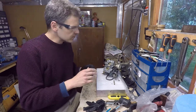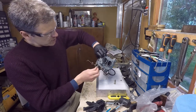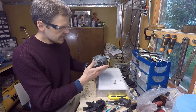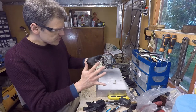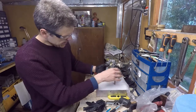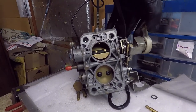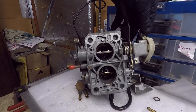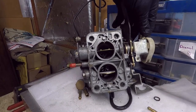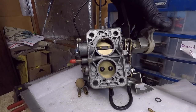This is the end of the project. The carb is fully built — we've got the operational manual choke, and I've put a new hose here for the vacuum choke pull-off. So this unit is actually rebuilt. The operation is pretty much normal up to about one third of the throttle opening, where you've only got the primaries. Then that's where the modification starts coming into play, because you've got much less restriction to the airflow than you had initially.